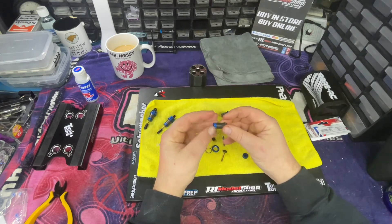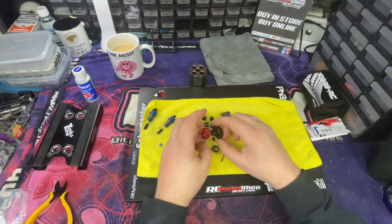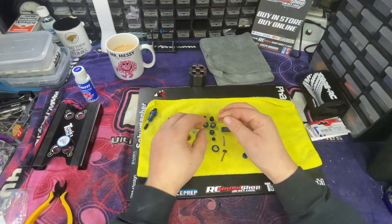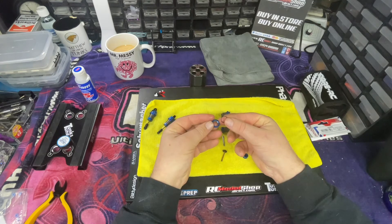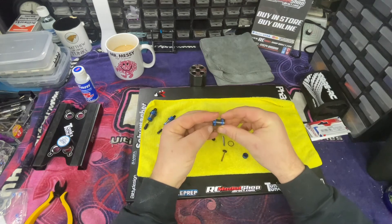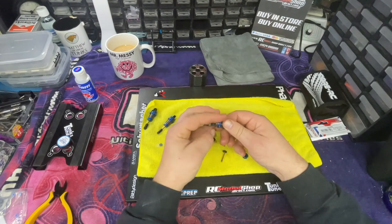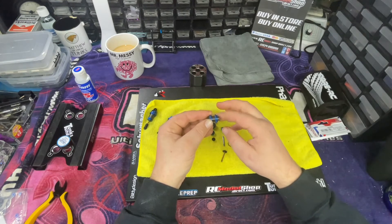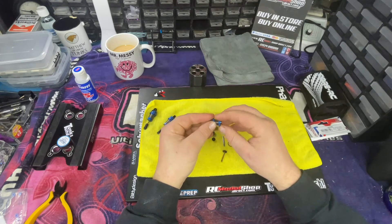Get one of the bottom caps. I'm not going to screw the bottom cap on all the way because I've just realised I've skipped a step. This step is quite important. I've seen many times over the years where people don't put this little ring inside your spring seat adjuster or your spring collar. What happens is if you just put that as it is with no O-ring, that'll just spin round on there. As your car is going over bumps, it's just going to be free to move around, and you'll end up with different ride heights and different corner balances.